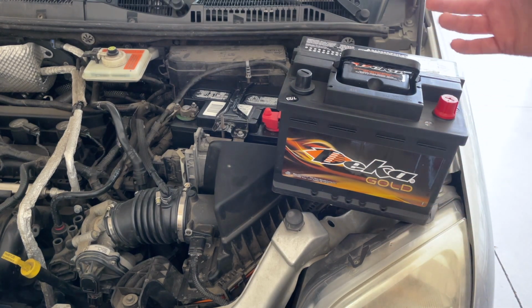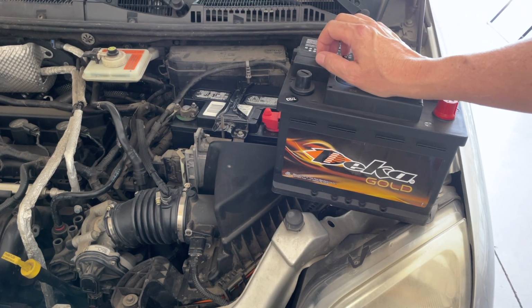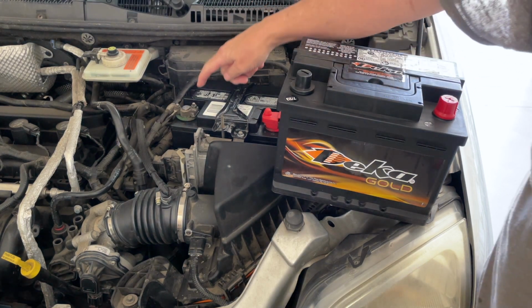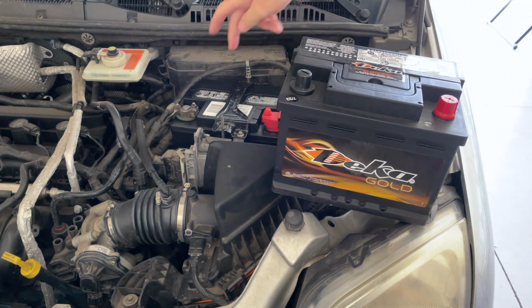And the old battery started really strong. So I'm going to have to change my view of reviving or restoring an old car battery with a stick welder. Because it definitely made a difference doing all those cycles, 5 on and 10 off, with the stick welder. Because that old battery wouldn't even start the car. It was just dead, and wouldn't take a charge, but now it seemed to be holding up pretty good. But I'm going to replace it anyway. It's 7 years old, and at some point in the near future, I'm sure it'll let me down.